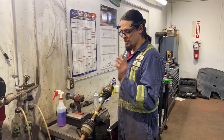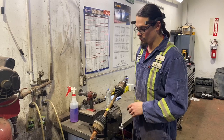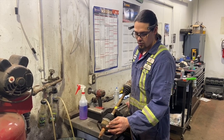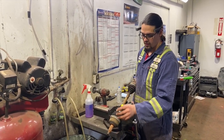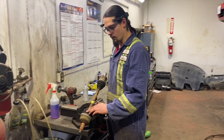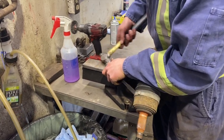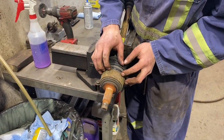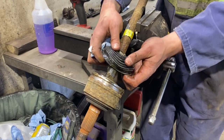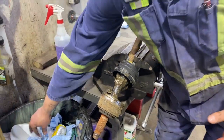Okay, so just so we can keep our wheel bearings tight, I'm not 100% sure by just rolling it in and out if that would damage them at all. We might even be replacing them, but for now I'm just gonna separate the outer side of the CV shaft so we can at least tighten it back up in there. We'll just have this one section on both sides of the vehicle. So to do that, we just gotta pull our boots off and smash off the end here. Probably just pop the thing off. Give me some space because we don't care about this.